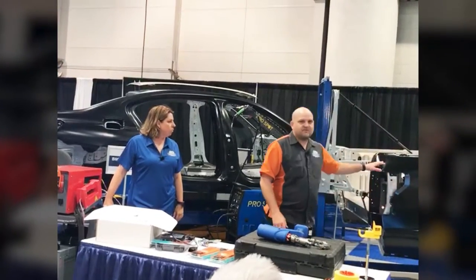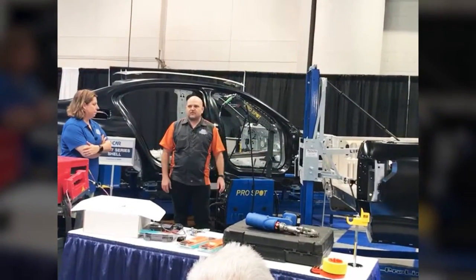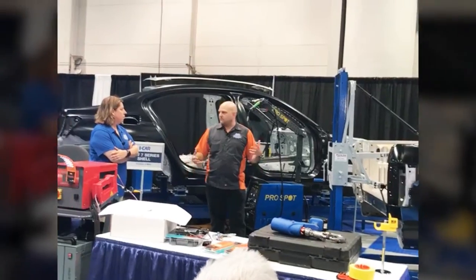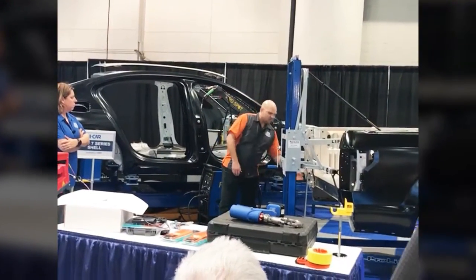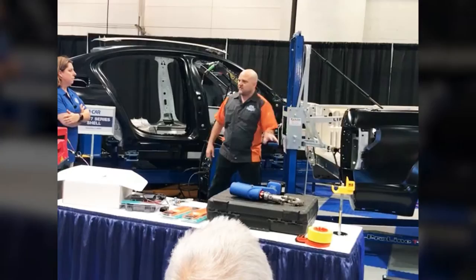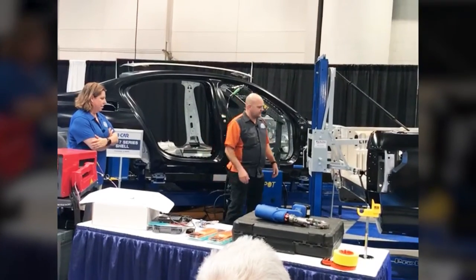And since we're talking about the F-150 box, another cool tool we picked up this week while we're here is this truck bed lift kit here. So what we can do is unbolt our box, unbolt the bed, rather than trying to lift it up with a bunch of people. We slide the tool in there, extend the arms, put some clamps on here. These will actually adapt. They will go onto the tailgate as well. However, this vehicle does not have that part of the component installed, so we're using some fasteners here instead.